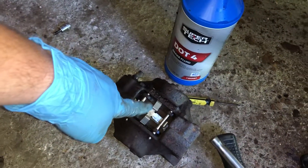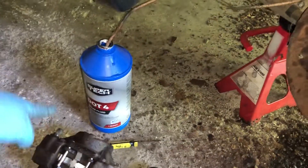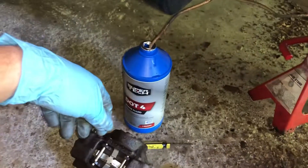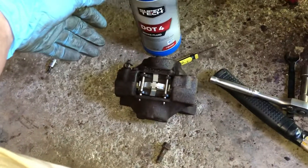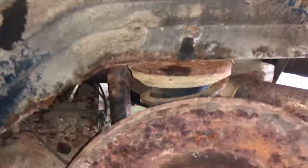I'm getting a new fuel filter today. I pulled working rear calipers off the parts car — 'working' means they go in and out, and the big one is that the bleeder screw moves. The ones that were on the car, you'd try to turn the bleeder screw and it would just snap — they were fully toast. These from the parts car are okay, with 160,000 miles on them.